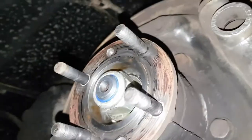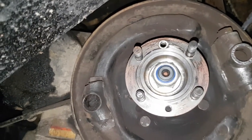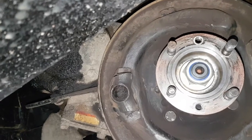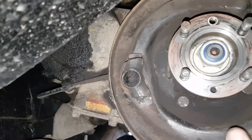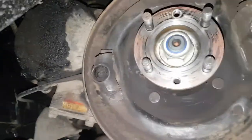I've given the area a bit of a clean up. I want to get on and do this because it's raining. I'm going to put some copper grease on where the shoes actually contact — like here and here. With these ones you've got to put them on as one whole piece, because the springs pull each shoe in to the centre and these stops hold it in place. I need to sort the tripod out because I can't do this and film at the same time.